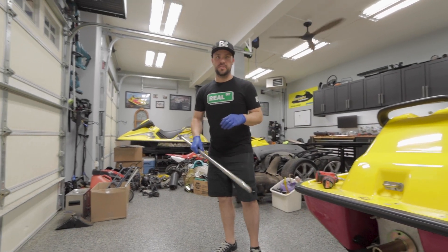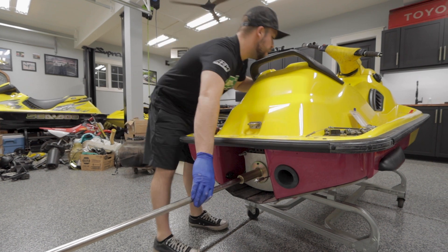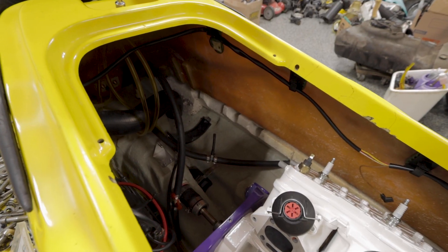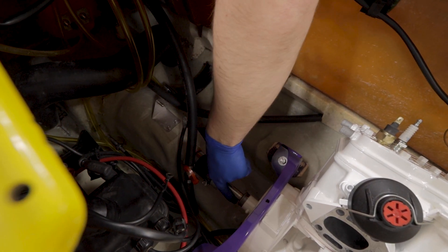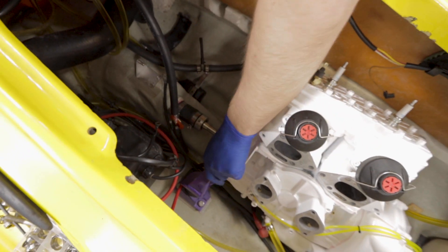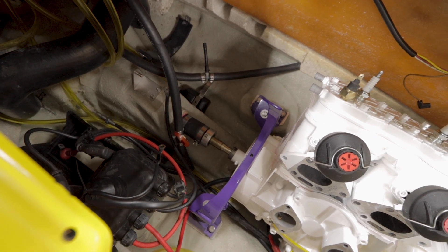Here's how I do it — I'm sure there are other ways, but this is how I do it. The engine's completely loose, all three bolts are loose. Your mounting plate is secured to the jet pump housing. I'm going to put the shaft inside of it. No lube — you're going in dry. Now if you look inside here, it's hitting on the bottom side of the PTO and it's hitting this side of it. So it's on the bottom and this side, which means you need to go down on this side. So I'll loosen up this mount now.